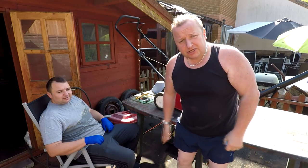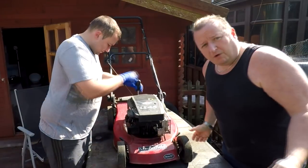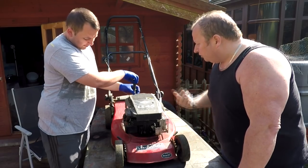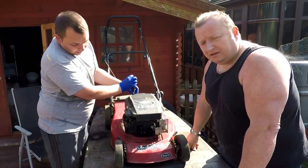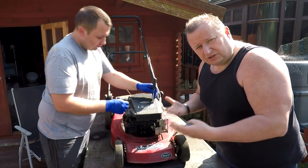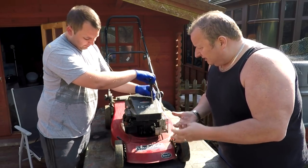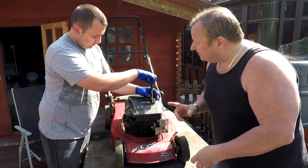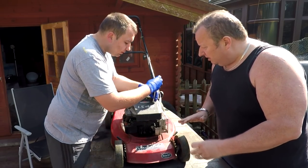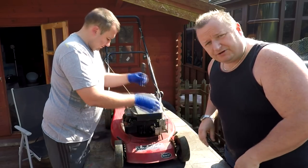I'm the old boy, it's his job - he's all gloved up, I'm getting dirty, carry on. What we've got here is a Mountfield 46cm 18-inch cut lawnmower. What's the problem Gary? It's just running when it wants to - doesn't always start, and when it does start it's hunting. Sounds like a typical carb problem: the diaphragm and gasket. He's already checked the oil level, which is just over maximum - never good to overfill. We're going to take the top off, have a look, change the gasket and diaphragm, and hey presto, the job should be a good one.